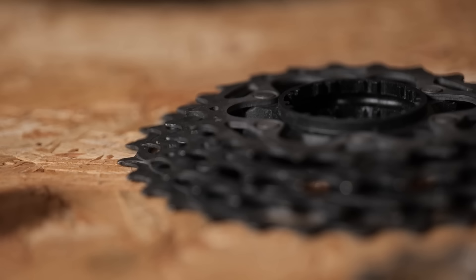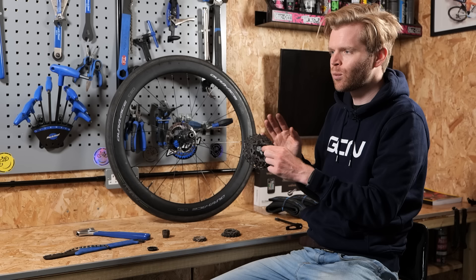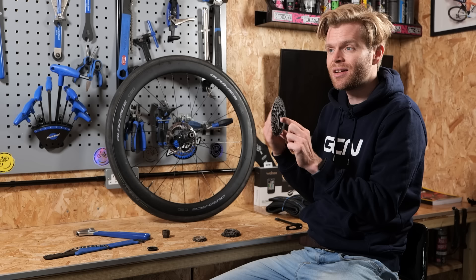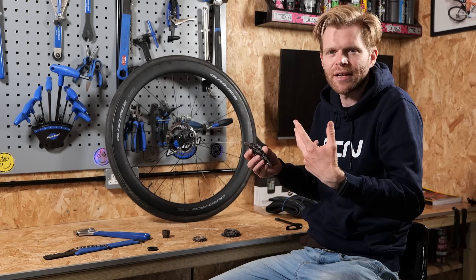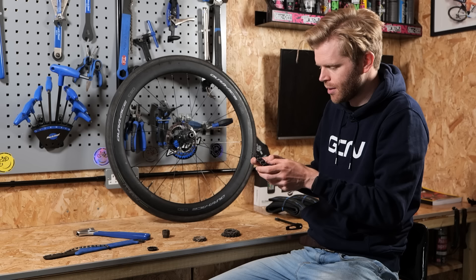One of the things I love about the new Dura-Ace is the cassette range — you've got 11-28, 11-30, and my favorite, the 11-34, which means a whopping gear range, ideal for hills. I live in a really hilly place in Bath. Because it's 12-speed, the gaps between the sprockets aren't huge, so it's also a good all-round cassette for flatter terrain. I'm putting on an 11-30, which still has a nice 30-sprocket gear for the hills, paired with a 52-36 chainset for slightly bigger chainrings on flat terrain.